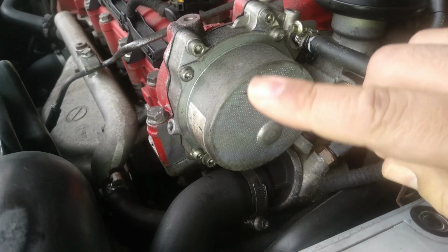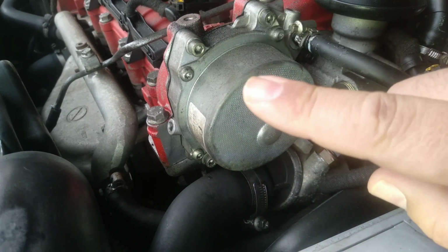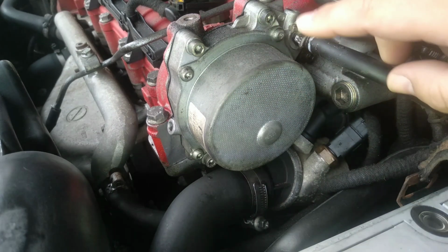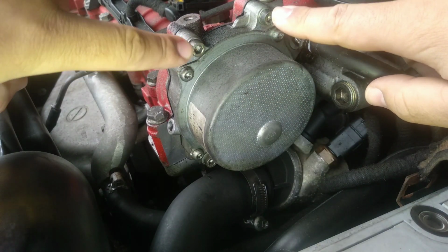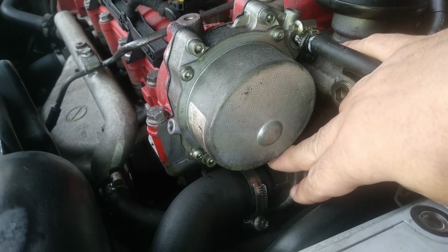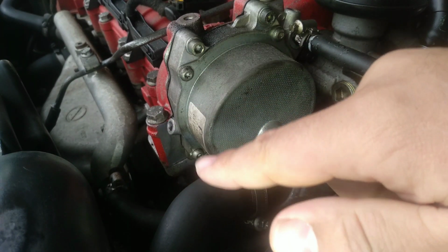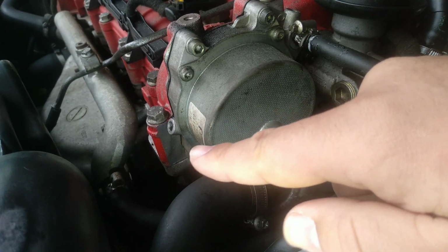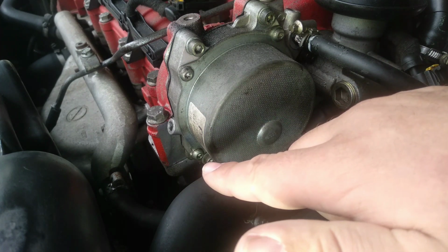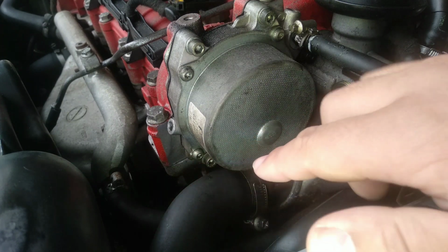This quick tip here may seem a little odd, but actually I already talked about this in another video on my Alfa 75. In here you have this pump for the vacuum, and it's held together with 4 bolts. Those top ones and one lower one and another one over there. Actually, the holes that are on the valve cover are drilled through all the way, or most of the way, and with age the oil actually comes out through the bolt itself and drips along the head and drips on the ground like I told you earlier.